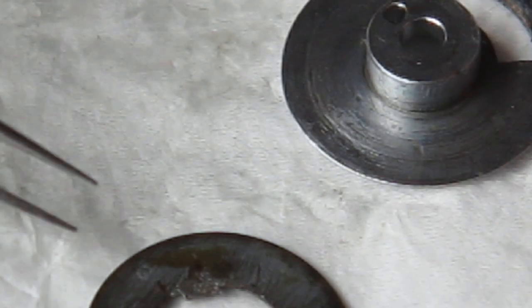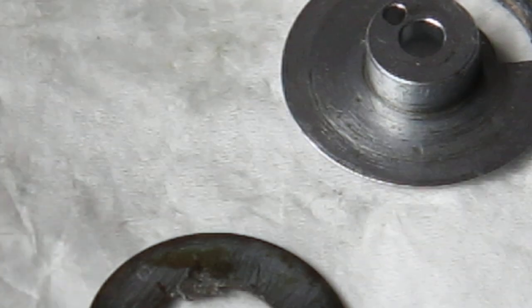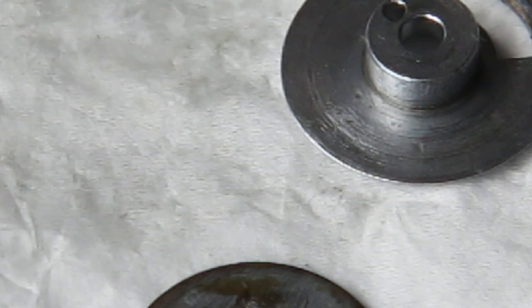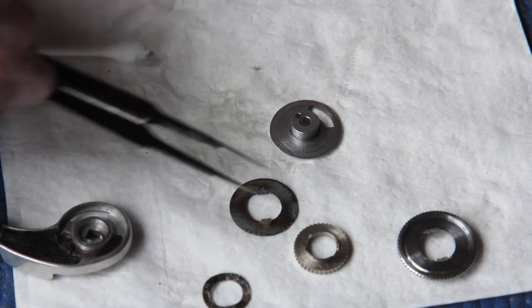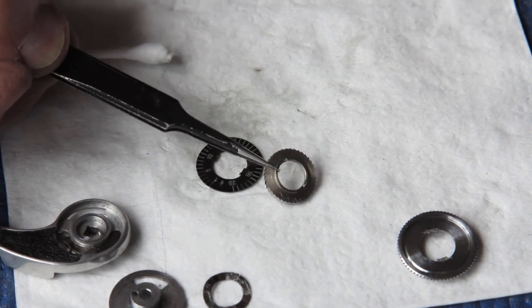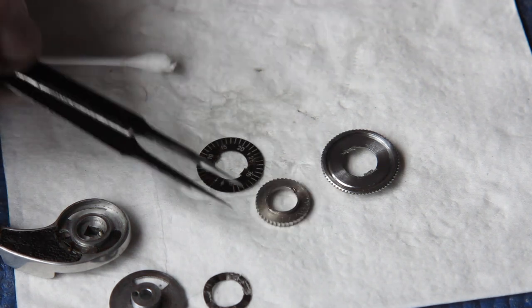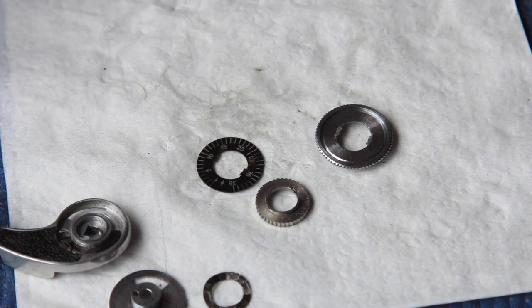I'm going to have to replace all of these parts — those three parts are just shot. That disc is damaged, I'll need to replace it. This little pull here, this counter piece, that ratchet — that's damaged and needs to be replaced. This piece here is damaged and I'll need to replace it. If I replace all those parts, I expect I'll be able to get the frame counter to work correctly, and more importantly it will register the end of film at frame number one, not frame number two. Now to sort through my parts — back shortly.